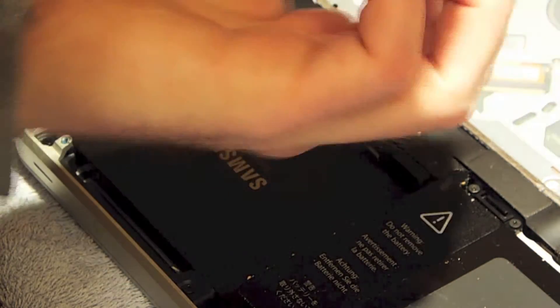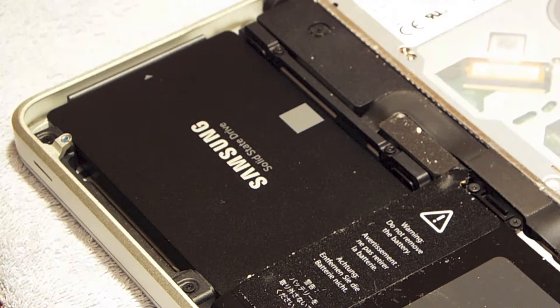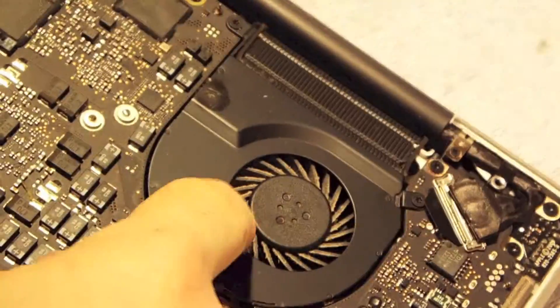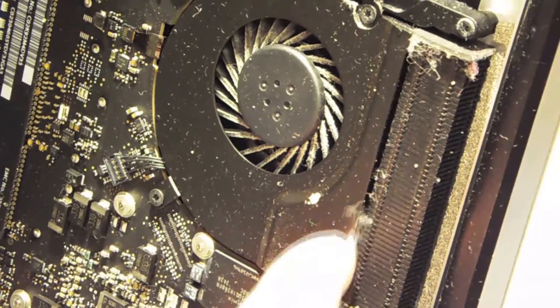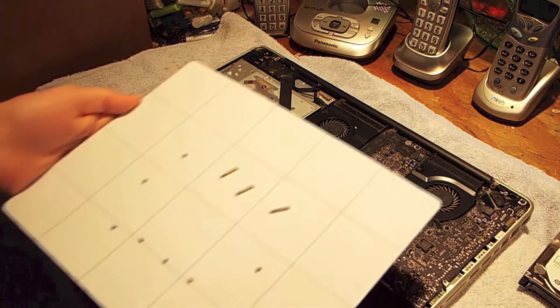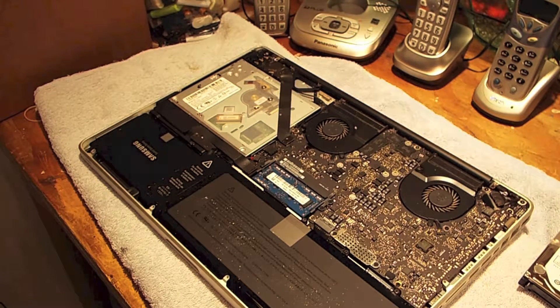Back to the standard bit because these screws are standard screws — and that is it, really. I'm also going to clean out the fans with compressed air because there's quite a bit of accumulation in there, and from this angle you can see it's pretty much fully blocked. But that's the procedure — it's relatively simple. Putting the cover back on is easy too. Most screws are the same; the only difference is the top right has three longer screws. That's going to be it for this video — thanks for watching, comment, subscribe.